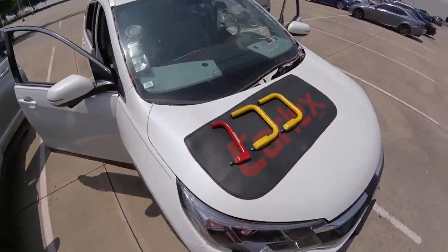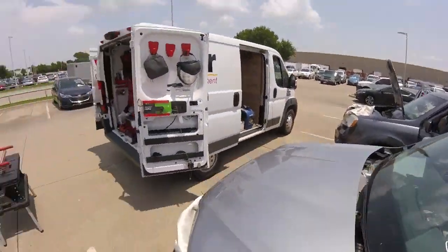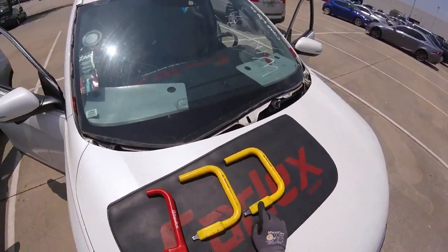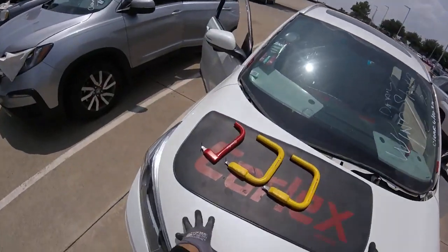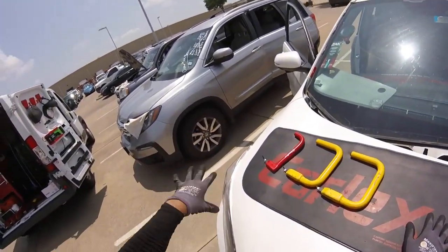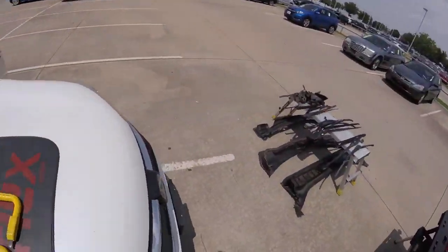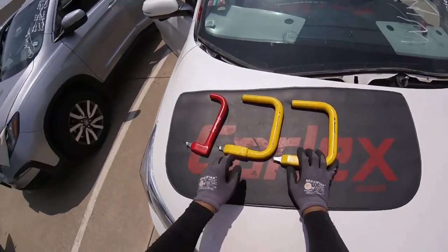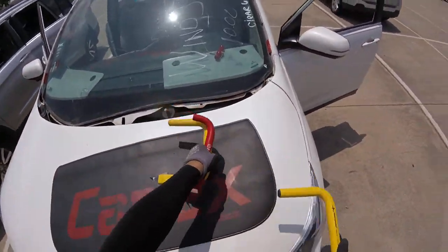Welcome, one more day. Today we're going to see the power of the zip knife. We're working on a 2015-2019 Honda Pilot and a CRV — we landed parts for both. I'm going to go fast; it's a lot of work. I'm going to do these three jobs at one time: pull them out faster. It's what I call the serious job — one-two-three: strip three times, cut them off, clean up, then install the glass. I've got my glasses ready, primer and everything. We'll use three-quarters, one inch, and one and a half blade settings to go faster.